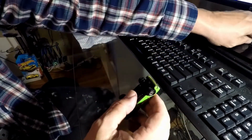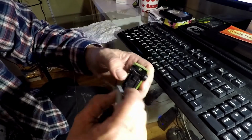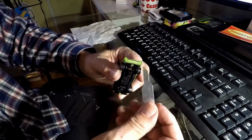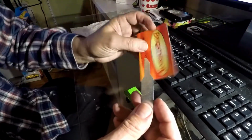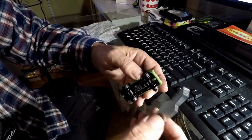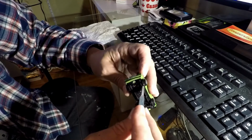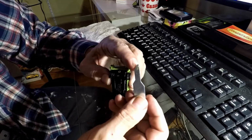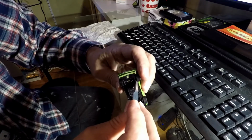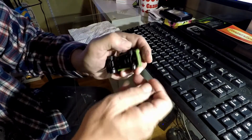Here's a way around all that. Take you something small, a small flathead screwdriver, right? Because again, there's the axle. Or one of the tools that you can get from Bright Vision or the Redline shop. Get you one of the tools, and sometimes you go in this way, but since the axle's stuck to the wheel, because it's got a little cutout that's made for the axles, you can go in there and hook the axle and try to do it. But typically, if it's locked on that tight to where doing this will not break it loose, that won't work.